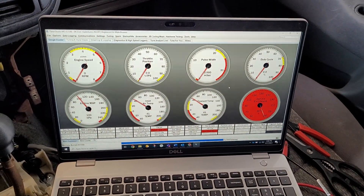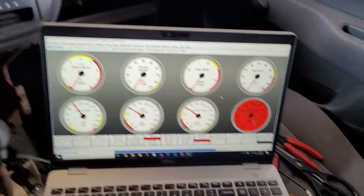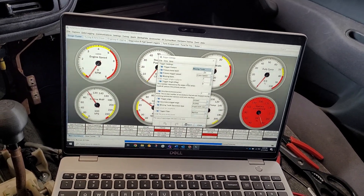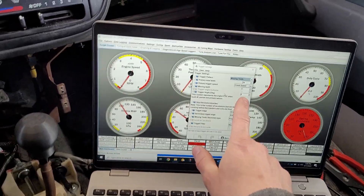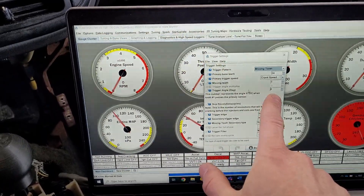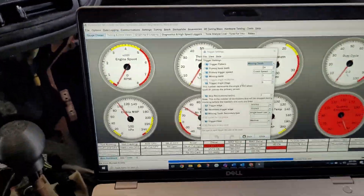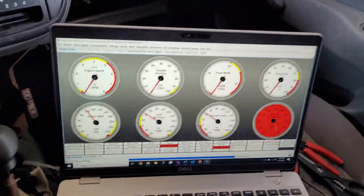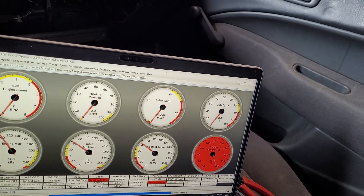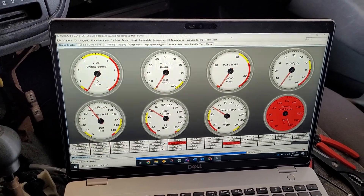I know it's really tempting to just go in there and start cranking and hope for the best, but don't do that. Even if someone else with the same J-Series and Speeduino setup gives you a trigger angle value of 55 or 280 — whatever number they give you — do not just put that in and start cranking. Put the number in, then verify it on the damper with a timing light. I've had a few people reach out to me, and commonly the problem is people will just crank the engine and hope for the best, and wonder why it's not working. You have to fix everything that's wrong before you can move forward.